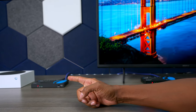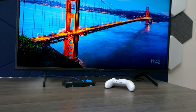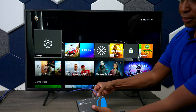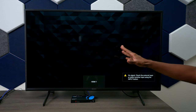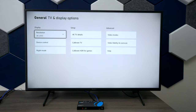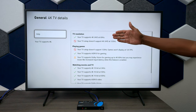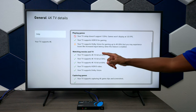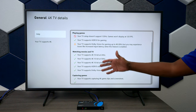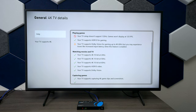With everything hooked up, let's give it a try. We've got the Xbox, the sender, and the receiver. Let's check out the settings on the television. I'll show you the adapter plugged in — when I plug it back in, you'll see the signal pop back up on the TV. I'm using the Xbox because we can see on the TV if we're losing anything. It's getting 60Hz from the Xbox, and you can see it's doing HDR10 as well as Dolby Vision — passing through everything from the Xbox to the TV through these adapters.